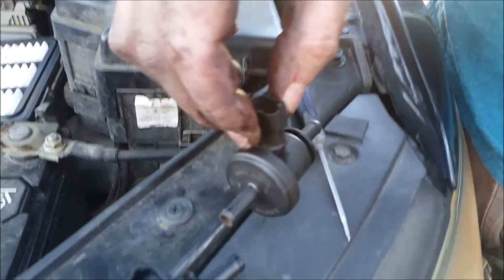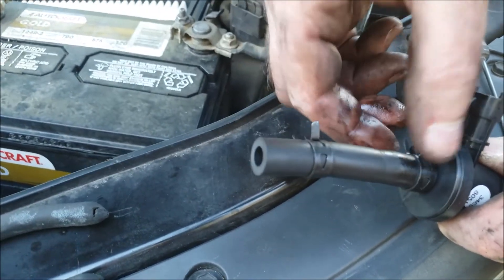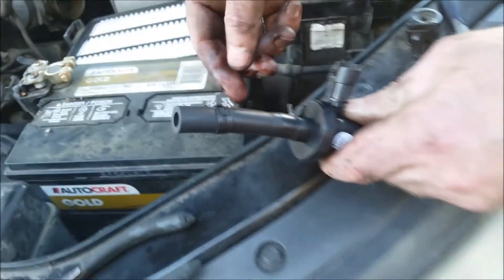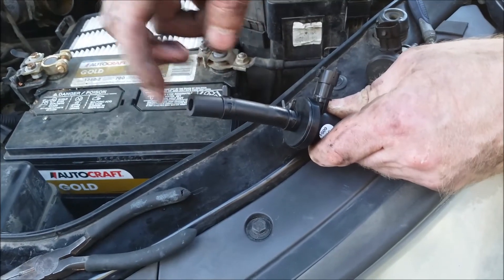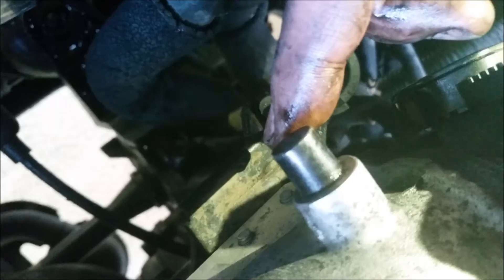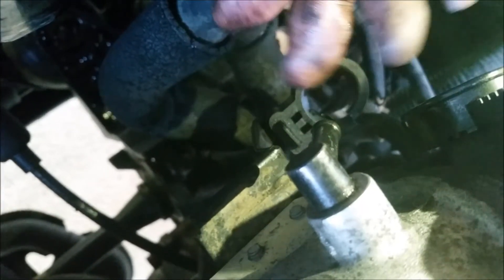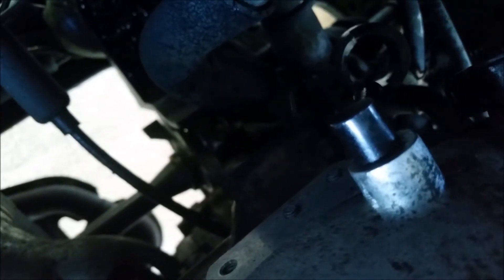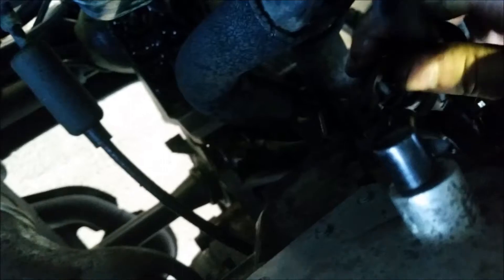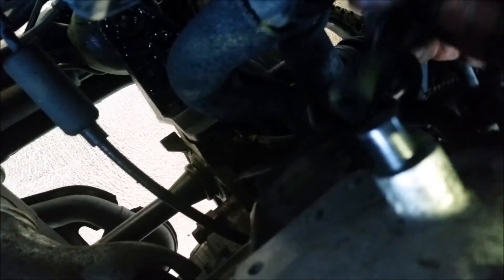Here's the old purge valve I pulled out, and the new one is right here. You install it in reverse. It's easier to put the tubing on the purge valve first, then slide it back in over that angled nipple. Once you do that, connecting the inlet is easy. Removing the old one was the hard part — there's the nipple where the hose connects. There's not a lot of room to work, at least in the 2008. After a lot of cussing and yanking, it finally came out. This is totally worth saving $400.